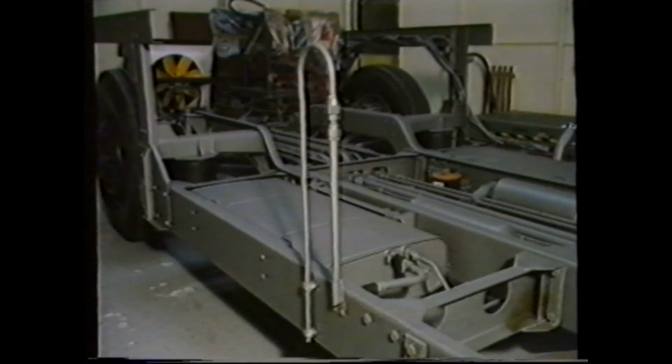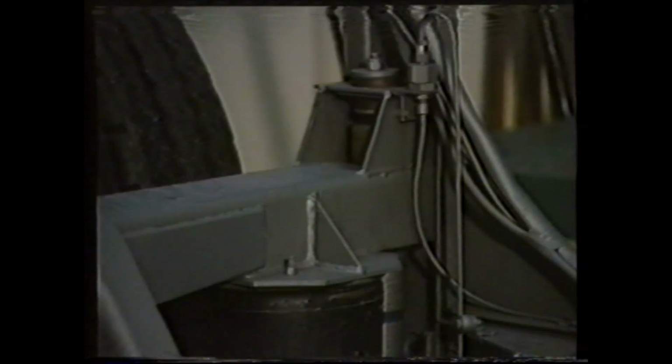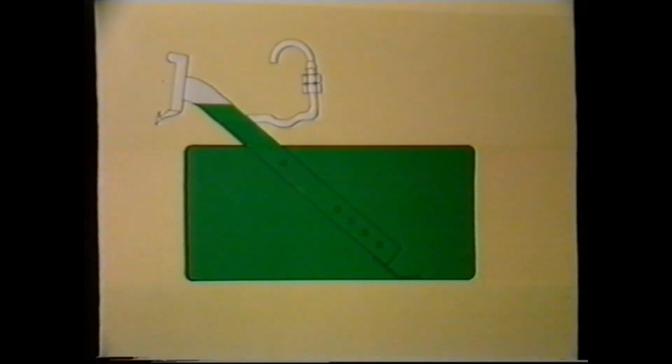Within the fuel tank vents, there is a check valve, which is normally in the up position. The purpose of the valve is to eliminate any fuel spillage should the vehicle turn over in an accident. It is important that the valves are fitted the correct way up, and the connecting pipe to the fuel tank rises continuously, with no dips. This also includes the connecting elbow, which again must point upwards. Take note, if there is a dip in the fuel pipe and fuel lodges in this, it will give slight pressurization on the fuel tank.